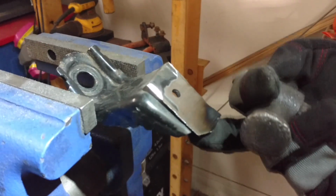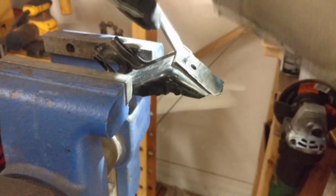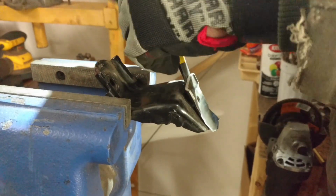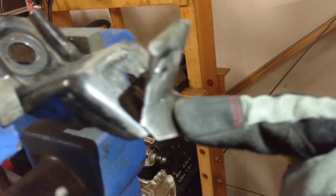You can see evidence of it on the back side. If I'm grinding this down to thin it out, then you can take a wedge type chisel and work it in there. Get it to open up a little bit, and that'll help you determine where it's at. You can see the little fold that it creates underneath the bottom edge where that weld is.